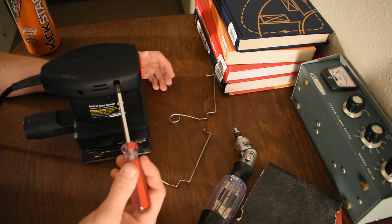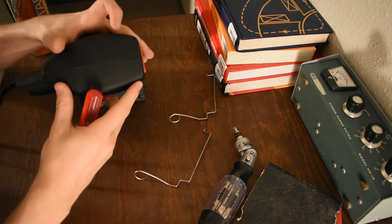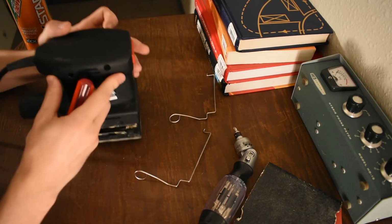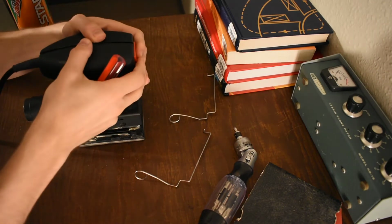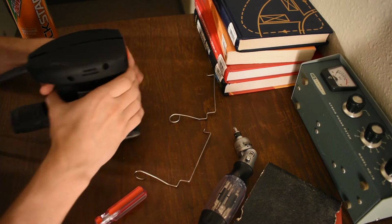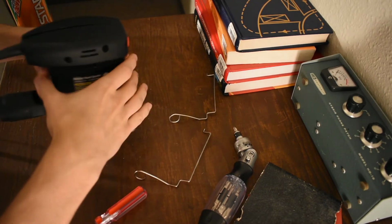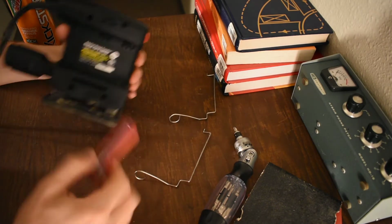This is actually a good thing, because if they just put the screws on the outside, then you're clamping it over like 2-3 inches here, and you've got these long screws and they flex relative to each other. You want the mold to bring the screws close together so that you don't have to mess with that. Otherwise they'll flex, right? The longer the screw, the worse it works, and the more expensive it is. So they're spending more money to make the thing, and the performance is worse.